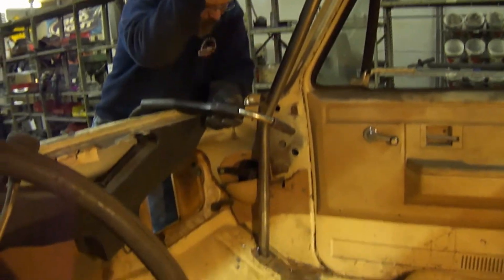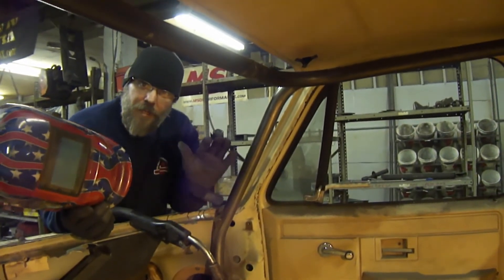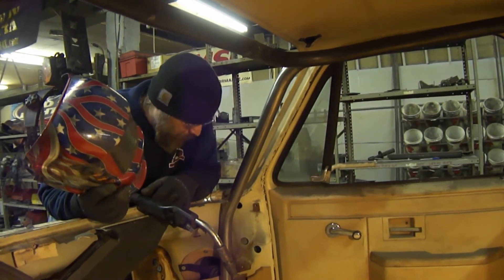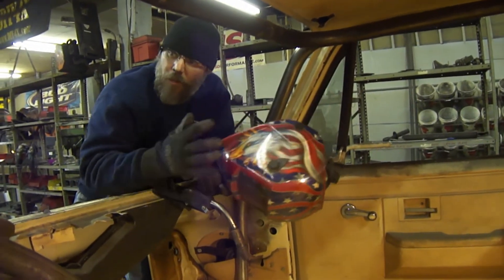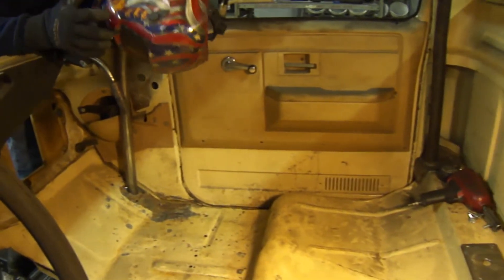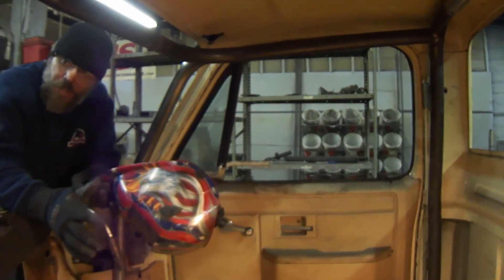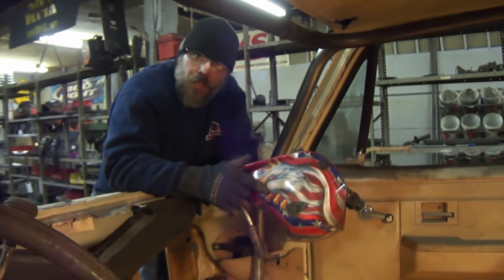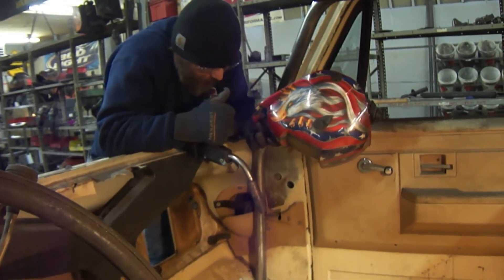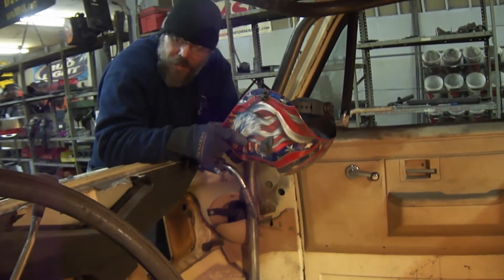We've dropped the cage through the floor. That's giving us an extra inch and a half of room on top here to do our finished welding on the top of the cage. It really makes a difference in how you get up here. Keep in mind we don't have a windshield in here — there's no glass, no carpet, no seats, anything. All of this is going to make a huge difference in how easy or difficult it is to put this cage in. We'll go ahead and finish up the weld on the top, put our floor plates back in, do our final welding on the bottom of the A-pillar legs, and then the cage kit is complete.